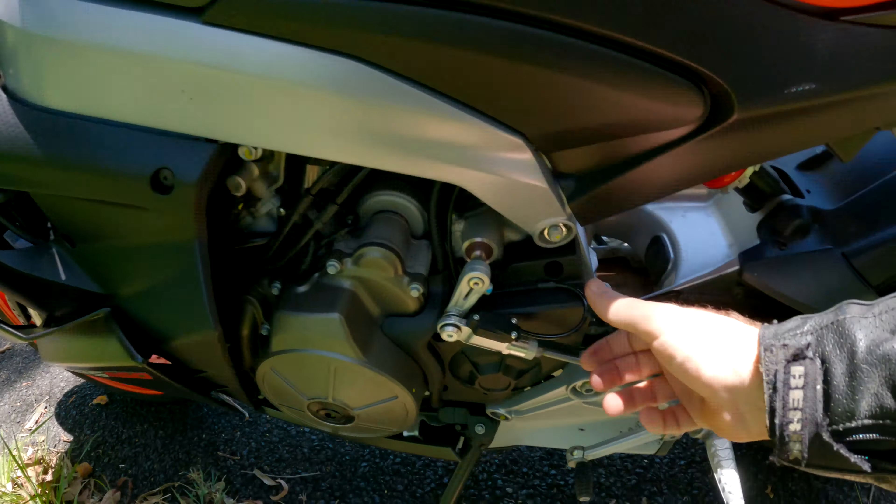There are only a couple of nitpicks. The front and rear suspension are adjustable for preload and damping — at the front you can get to it quite easily, here's your preload and there's your damping on both sides. On the rear you adjust your preload here, but unfortunately the rebound or damping adjuster is all the way up in here — it's so high up you can't even see it. To adjust it you need to take off the rear seat, undo two allen key bolts to remove the fairing, and then get a screwdriver in through there. I wish they'd put a hole through or used a remote reservoir on the shock.